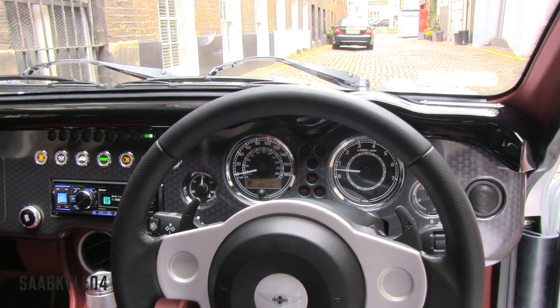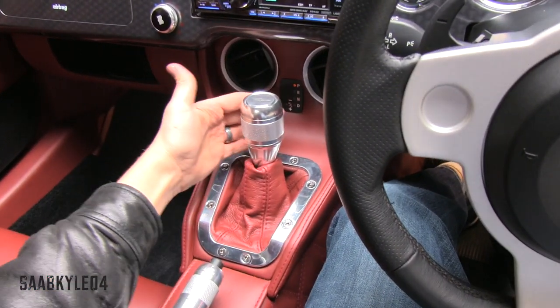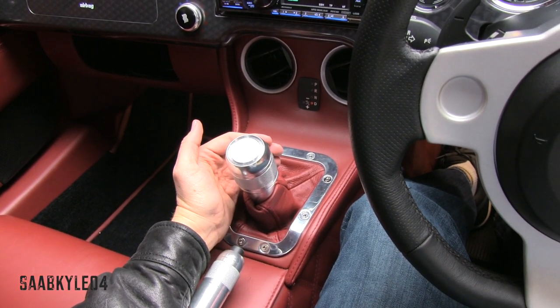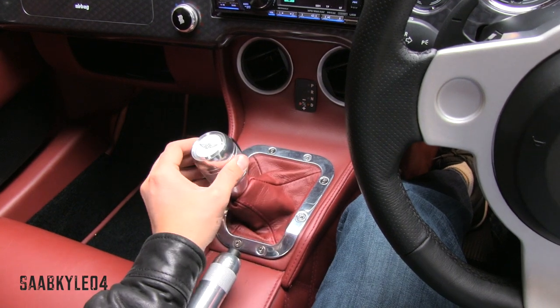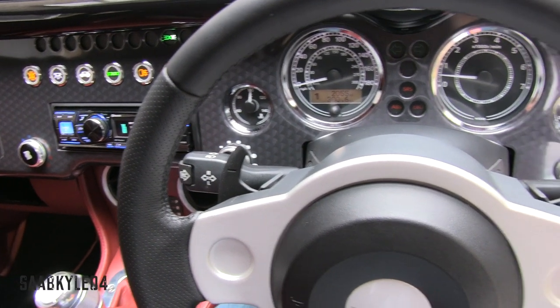Earlier Aero 8s were only available with a 6-speed manual transmission, but with the introduction of the Series 4 in 2008, ZF's HP26 6-speed automatic was offered for the first time, in addition to a standard 6-speed manual, sending power to the rear through a limited slip differential.